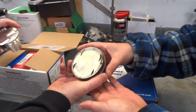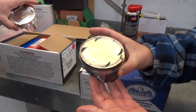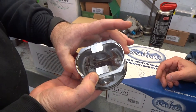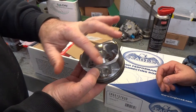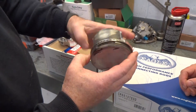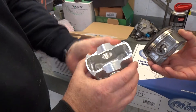This is actually out of a Version 11 — a bit later model than your car — but this is a semi-forged piston. It's got a forged top on it but a cast bottom. You can see all the casting marks in here, you can see where it has been machined and where it hasn't. Just a little bit different style — still a good piston, but not quite as strong as these forged pistons.